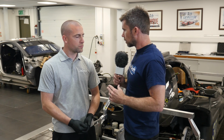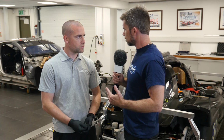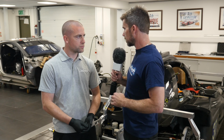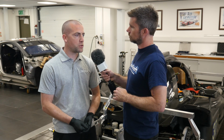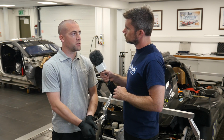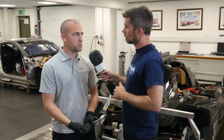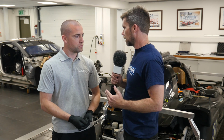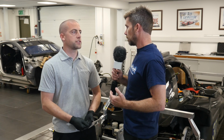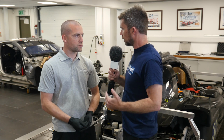All right, last point I wanted to talk about there is the ride height, which you've mentioned. So is there a specification, first of all, on the minimum ride height for these cars that you have to stick to, or is this more a case of your own personal setup? It's personal setup, but due to the skids underneath the floor, if the car is too low, they'll wear excessively below the limit and then you will be excluded. So there isn't a minimum ride height as such, but the ride height is dictated by that skid wear. That skid on the underside of the car, essentially it's a motorsport level plywood, for want of a better term. So you start with that at 25 millimetres thickness, and what are you allowed to run down to?